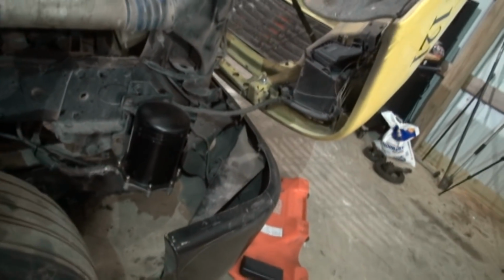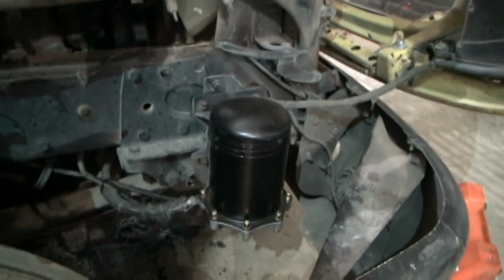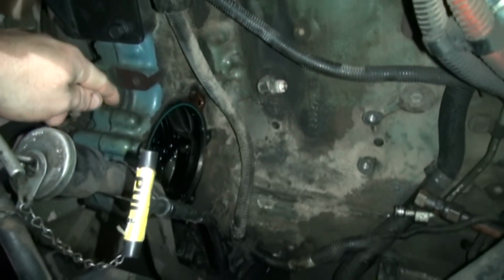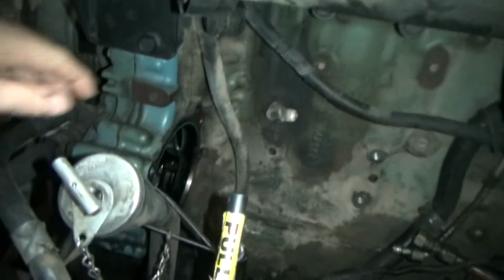He had an air leak. Wasn't building air pressure. Did some testing. It's the air dryer, or was the air dryer, was part of the problem. It was blowing air out of the purge valve on the bottom down there. Got the compressor off of it now. It goes in here, and we're putting new coolant lines.